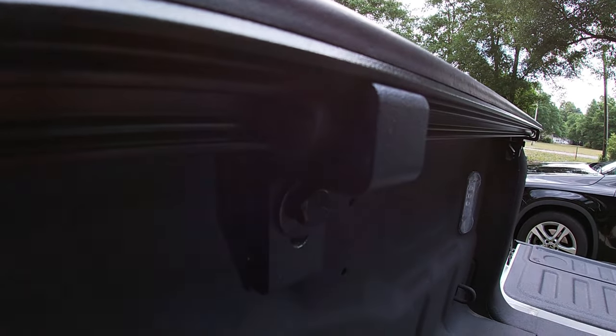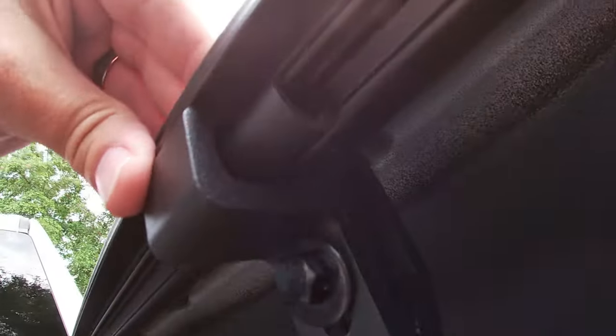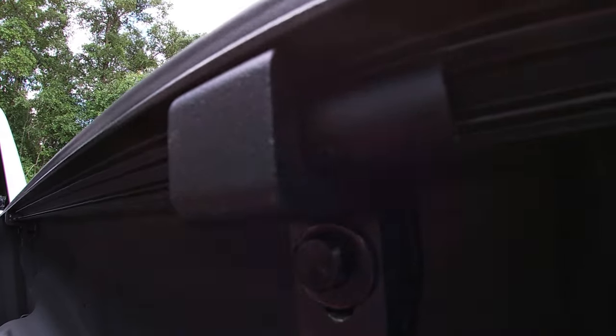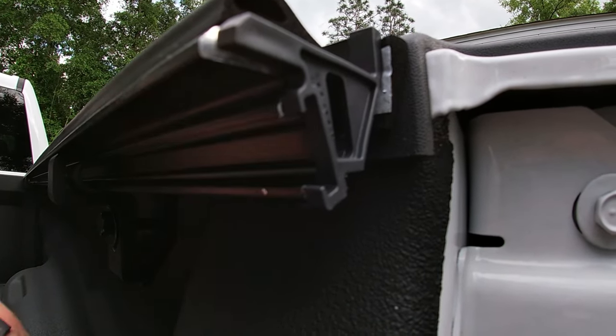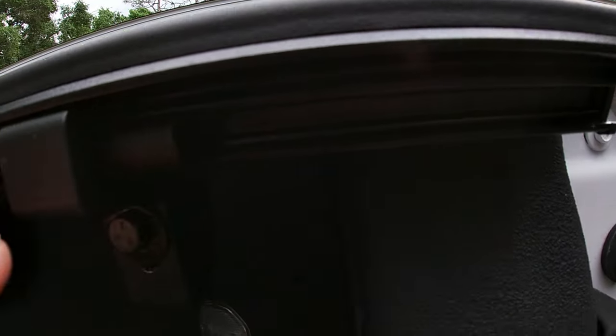When you look at your rail spacer, you don't want the clamp sitting on the spacer — you want it to go up into the edge. There's a little notch or groove that goes all the way down, and you want your clamp up over the spacer in that groove, clamping on the metal of the rail, not on your spacer. Different trucks differ, so if you've got a really short bed rail and can't get the clamp all the way up, that's why they give you the ability to drop it down a little bit.